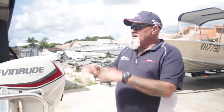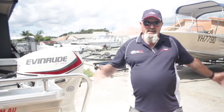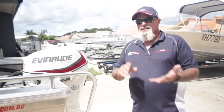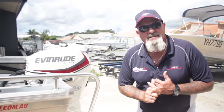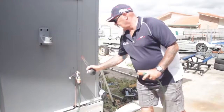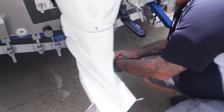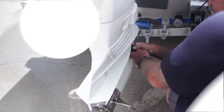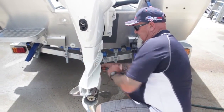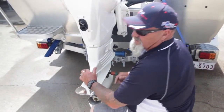Let's start. We've pulled the boat out of the shed or out of the garage. We've got the motor down because we need to do that to fit in our sheds, because they're getting shorter and shorter and the boats are getting bigger and bigger. So first things first, there's no point going to the boat ramp if the boat doesn't run. Let's start the motor. We're going to grab our flusher muffs and hook them on. The intake is through these grates on both sides, so the important thing is to make sure that it's fully covering them. We've got that on nice and secure.